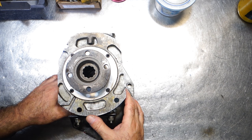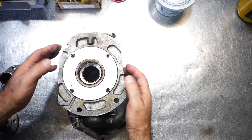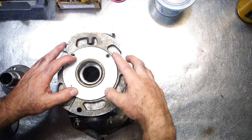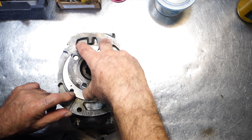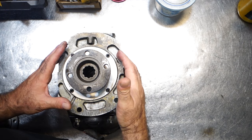Because there was only one prototype and people were starting to ask about them, we had to come up with a better solution for an extension housing. I didn't have a lot of dollars to make a casting at that point, so we had to be creative taking existing extension housings and shortening them. I was able to get the main shaft stock and the fifth gears to work, but the challenge was making the extension housings. I took that tail housing off the JT5 prototype just to show a better view of how that insert was put in — originally it had a larger diameter register for the transfer case, and this piece was machined to fit inside that register bore, incorporating a bushing and a seal. That's how we converted from four-wheel drive down to two-wheel drive.